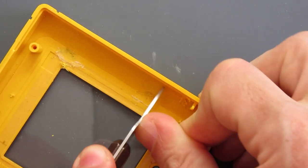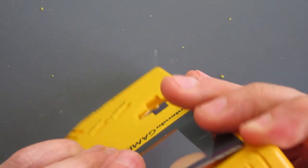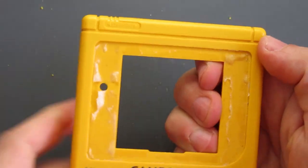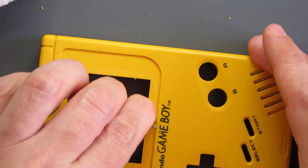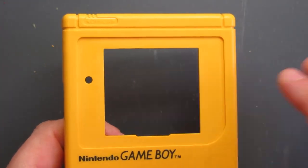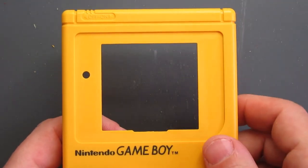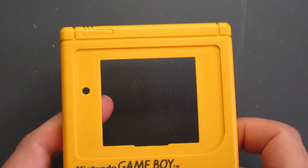It's all done. One of the other things about this Game Boy is the screen cover - I had a couple of scratches, tried polishing them out but it didn't really work, so this needs removing. Simply apply a bit of pressure from the back up one corner and it'll lift, then carefully lift all the way around. It'll leave a little bit of sticky mess behind. That's the point where people get lazy - they'll just remove the old screen and leave all the glue there. I'd always recommend removing as much as you can from that surface. The edge of a razor blade is really good for doing that.